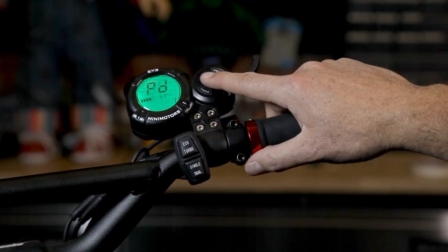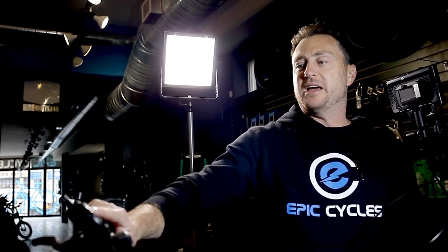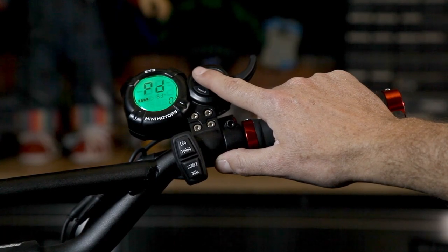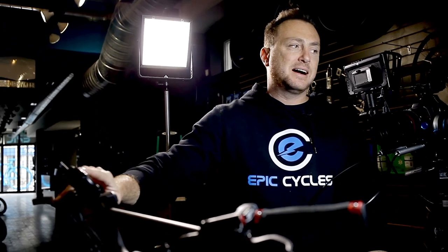PD, the final advanced setting, is your ABS anti-locking braking setting. A lot of times people contact us saying something's wrong with their scooter because when they hit the brakes, they get a certain sound — that's what the ABS does, and they think something's wrong. But it's actually a proper feature that can be changed within your display. It's commonly good to use in snowy or icy areas. If you find it annoying, you can simply turn it off by setting it to 0. Setting 1 will have your ABS on, and you can play with that to feel the difference when you hit your brakes.